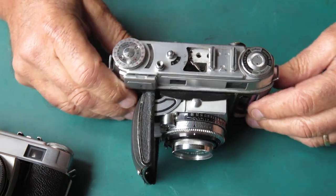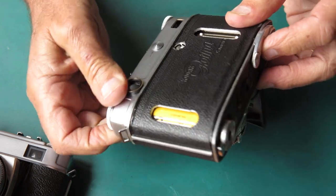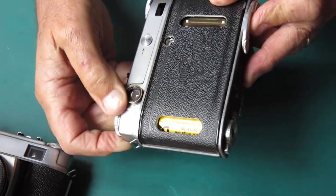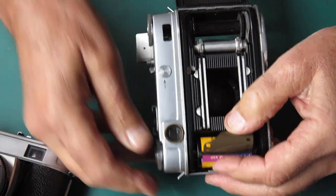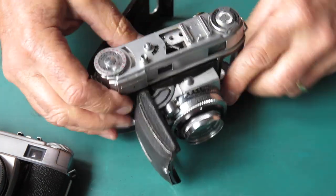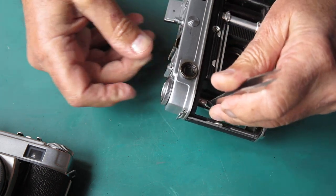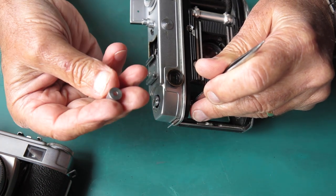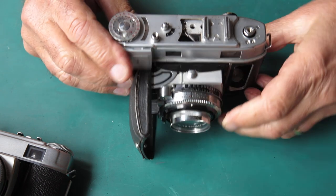To take the top off this particular camera, first I'm going to take the film out. As you can see it's got a few light leaks. To deal with this - the first type or more common type of 3c - the first thing you need to do is remove the rewind knob. I normally just put the tail of my tweezers through the shaft and unscrew the knob with my fingers, because you don't need a tool to take that off. That's the collar that sits underneath the rewind knob. On this model of Retina, we've got two screws at the top cover here, underneath where the rewind knob is.